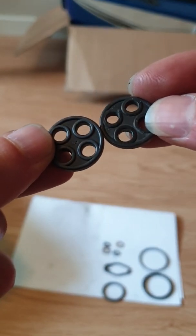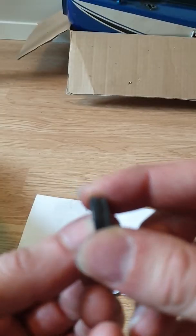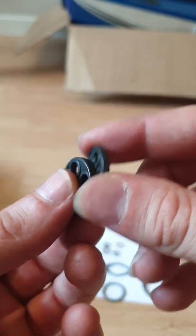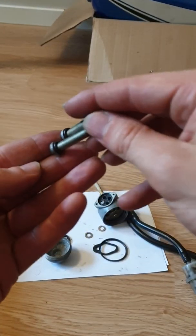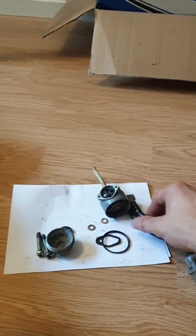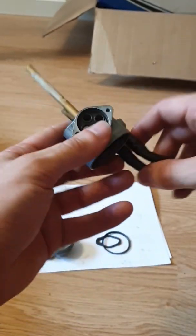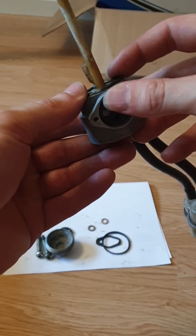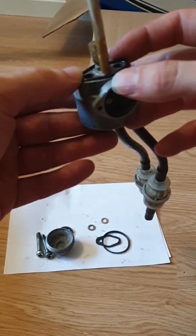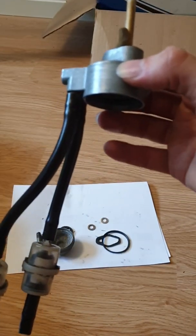I mean, it's not much to say. You can see it's a little bit more used, but not much. I mean, barely any difference in thickness, but since I got a new one here, I'm going to replace it anyways and have the other one for a reserve. Alright, I guess it's changed now on the screws here, holding the petcock underneath the tab here, and inside here this one fits like a charm, and also the gasket on top here. It's almost popping out from this groove, so you just have to press it down and hold it there a few seconds or a long time if you need. All we need to do now is just assemble this petcock and screw it back onto the tank.